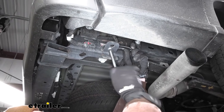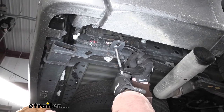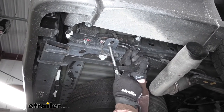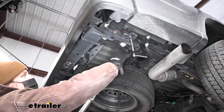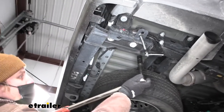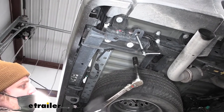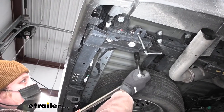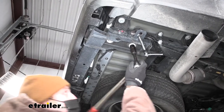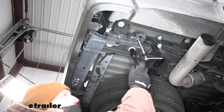From this point on, anything we do to one side of the vehicle, we're also going to do to the other side, because it'll be set up the same way. We're going to remove these factory bolts using a 21-millimeter socket. These are on there really tight, so you're probably going to need a big breaker bar to get them loose, or you can use your standard half-inch ratchet and find a pipe or something you can put on the end of the handle to make it longer and give you some more leverage. I'm going to break these loose, get them started, and then come back with my power tool and pull them out to speed things up.